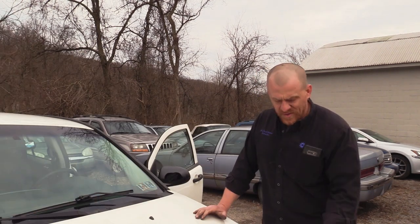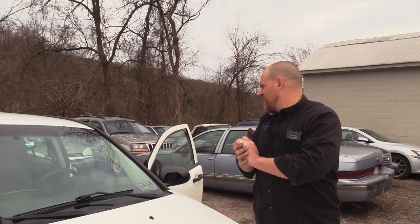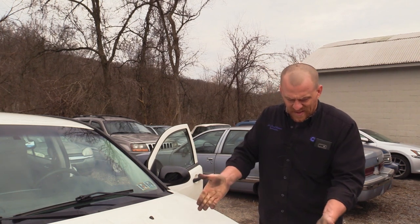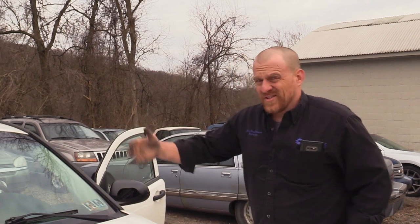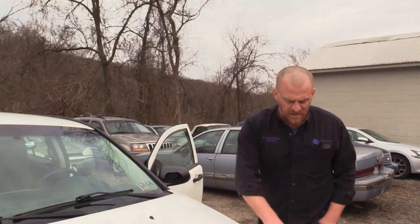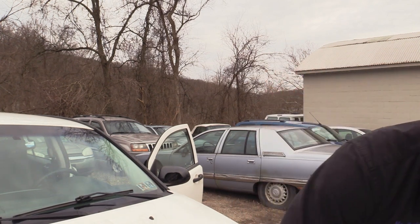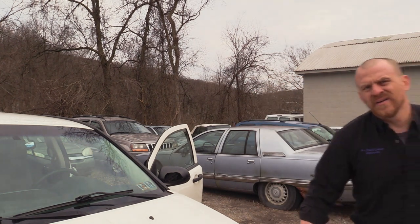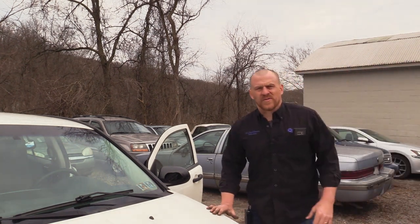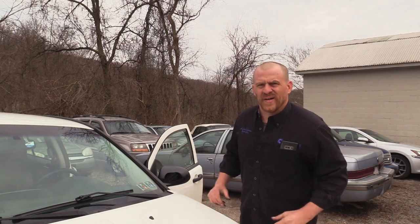So some unknowns that I was unaware of, this just had a thermostat put in it, is what Pete just said. And someone was in there, again, left the intake air temp sensor unplugged, so maybe that was the only reason the check engine light was on. That transmission code did not come back. Everything's working fine. Visually, I don't see anything wrong. That light, low speed surge I didn't like, but this is one of those things, how do you bill for something like this? How do you guys do it?